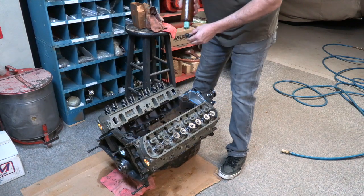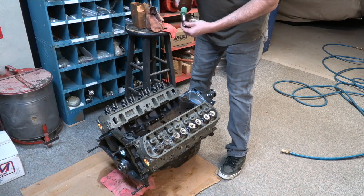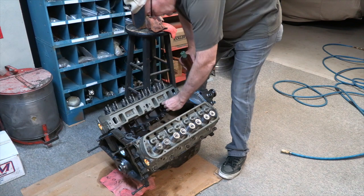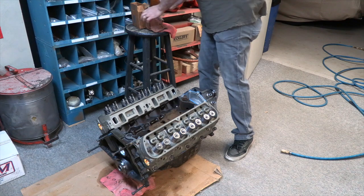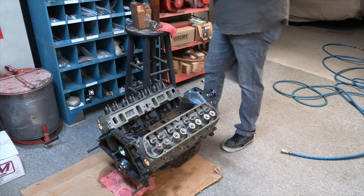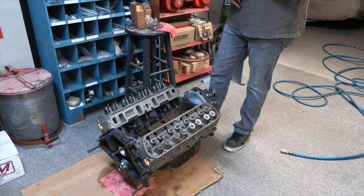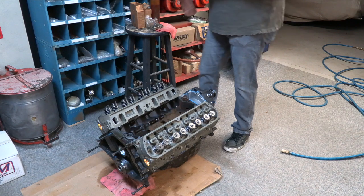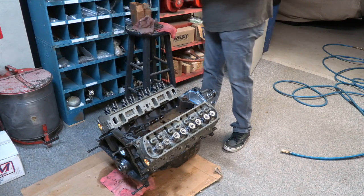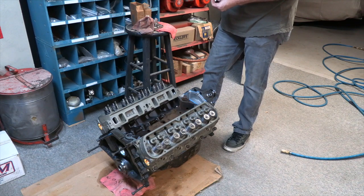Lube them up. There used to be some engine builder lube that was called PTA. I use STP as a lube. It sticks to everything and is good as you prime the motor. I prime all my motors for oil pressure before I ever start them, so I know I have good oil pressure right from the beginning. But this gives that first little bit of lubrication.